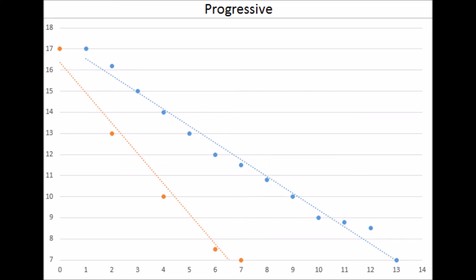This chart shows the curve for two springs. It's pretty clear that the compression of my progressive springs is almost linear, but it is possible to see a small difference along the curve. So progressive springs are not that different from regular linear springs.